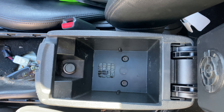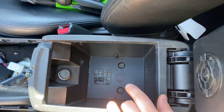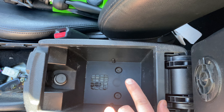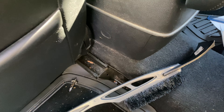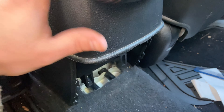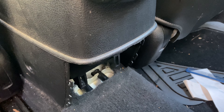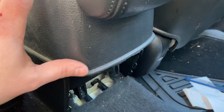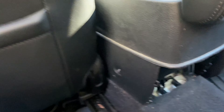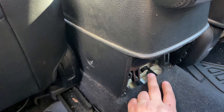In addition to the screws mentioned earlier, there's a piece of plastic or felt under here with two Phillips head screws there and one on the opposite side. Also back here, you probably don't need to take this whole center console out - you probably just take off this back access panel, it just pops off. I'm going to continue to take the console out just because it's really gross underneath and one of these cables is seized up, so I can't get my hand in there to pull it out.